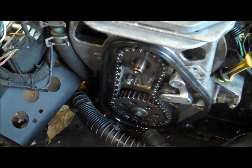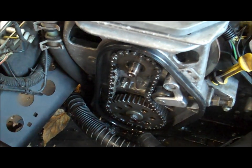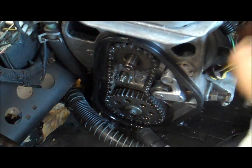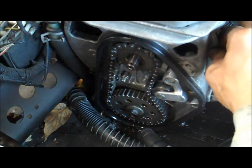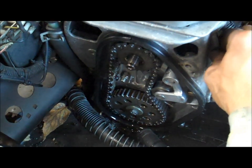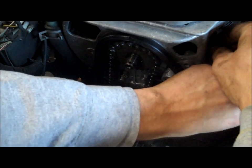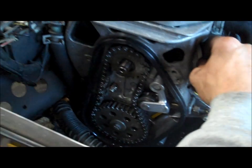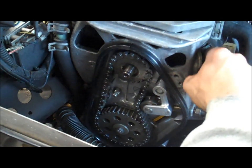An easy way of checking that — the cog and everything is not set up right on this one — but if you were to grab either your secondary clutch or your brake caliper and go to rotate this, before anything moves there should be just maybe about an inch, half inch of play. But again, this sled isn't set up right. If you need any further explanation about that, just give us a shout and I can help you out.